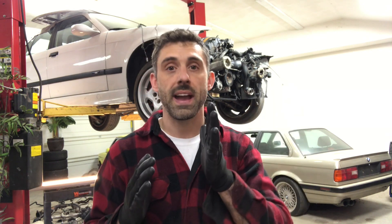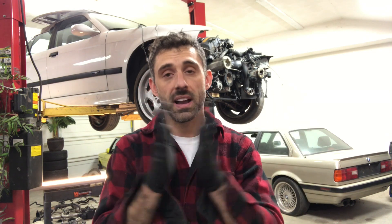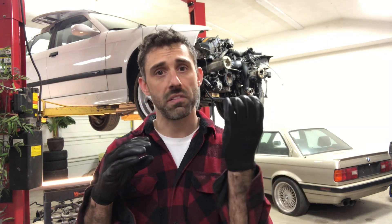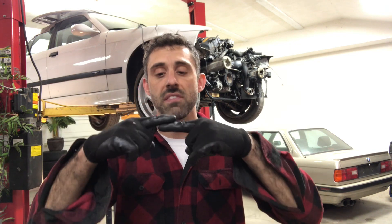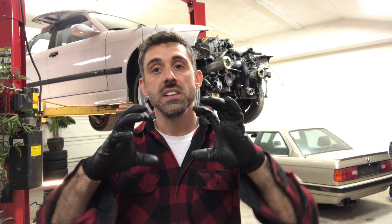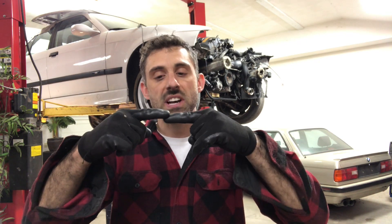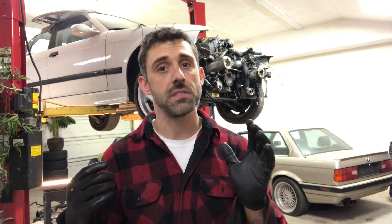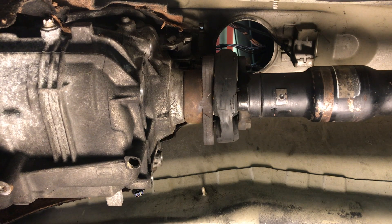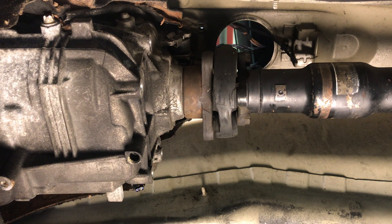So how do you do this? First, you want to make sure that the engine is as far back as possible and butts up against the driveshaft, and that the spline between the first half and the second half of the driveshaft has enough engagement to not only allow it to move forward and backward, but also to transfer the torque. If you have just a little bit of engagement on those splines, you're going to end up stripping them. So it's really important to have the engine as far back as possible — not just for CG, but also for stock driveline alignment. In our example, the first thing we're going to do is move that transmission up and try getting it aligned.